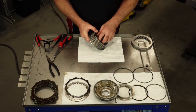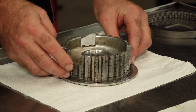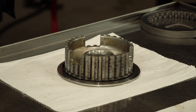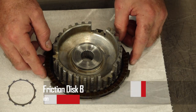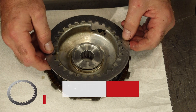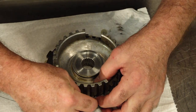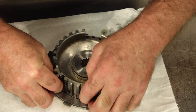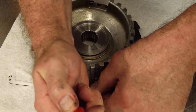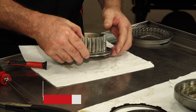I've got it cleaned up with O-rings in place. Now let's start putting the clutch pack together. First let's get in our spring seat, which is basically just the flat washer, then the judder spring with the beveled edge facing in. Now we bring in one of two oddball plates that we have, then one of our steel plates. Now we've got a new wire clip - put in the first end, then feed it around getting it inside the groove, and then get the second one pushed in. Just take your time, do it section by section, push down on the plate, then feed the wire into the groove.